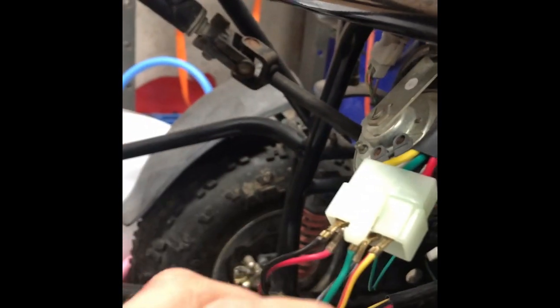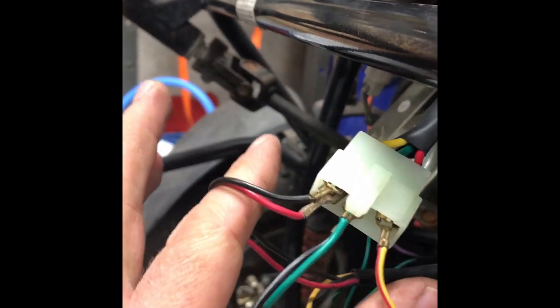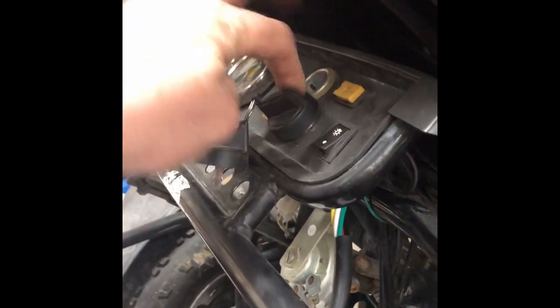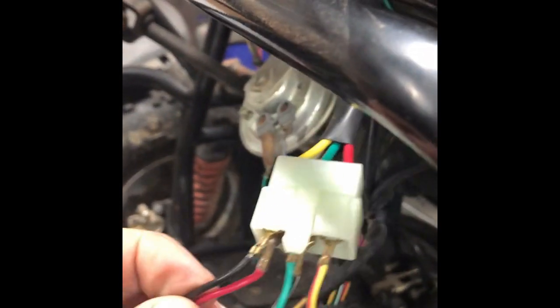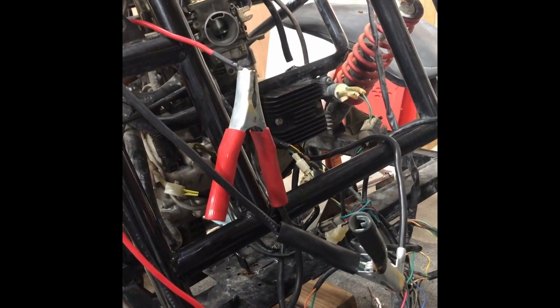This is a five-wire plug in a six-wire housing — there's actually five wires in a six-wire plug and they just didn't bother to make a five-wire plug. When the key is engaged to start, you have these two plus this one — three contacts all engaged. When you let the key go back to the on position, you're simply back to the black and the red touching each other. Let's venture to the back of the go-kart and talk about the engine and the wires coming out of the engine before we get to the CDI.